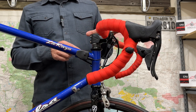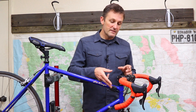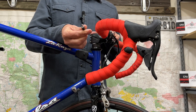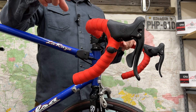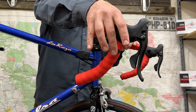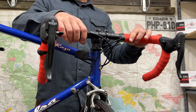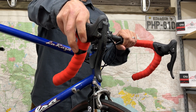The electronics and the battery for the MFR are housed in the pod, placed anywhere in the front of your bike. I've got it here on the top tube because I run a very short stem and there's not a lot of room underneath it. If you have a longer stem you can place that little pod underneath the stem and tuck it away. From the pod we've got wired electronic shifting buttons using a headphone jack. I've got the double strand on this bike — a single shift button here, one for my thumb on the back side, and then on the flats two more shift buttons so I can shift when climbing or descending.